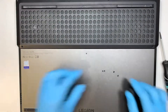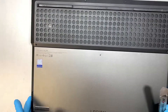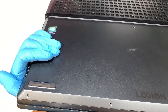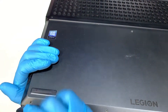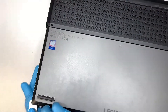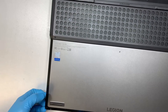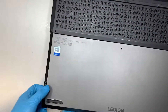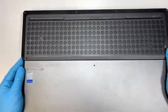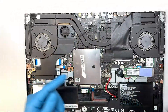Once you have removed all four screws at the bottom, put them on the side. The next step is to pry open the back cover. Go to the corner — whichever corner you feel has a little gap or opening. Mine is at the bottom left. Stick your metal prying tool in and get a good opening at the very bottom. Start working your way around by putting your finger in between and separating the back cover. On the very top, wiggle while lifting it up. Try not to yank it all at once — just loosen the plastic and open up the back cover.